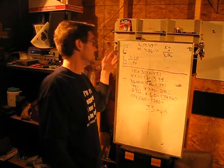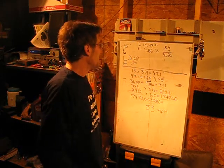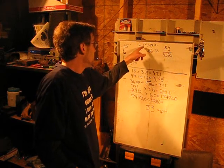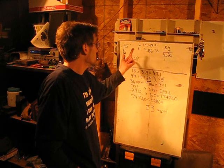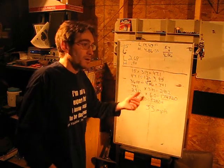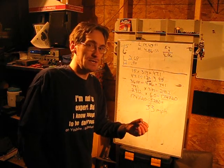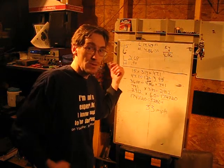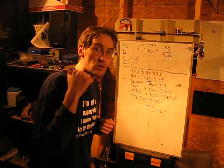You can go lower than that, and you rip your tires, depending upon, with 15-inch tires. Let's see, Allie's go-kart, the one in the most recent videos, her jack shaft ratio is at 10.8 with 15-inch tires, and you see what that thing does in the videos. They can sit here and do cookies all day long.